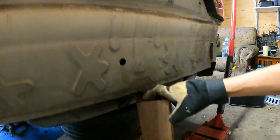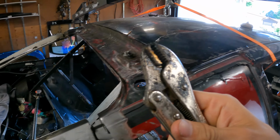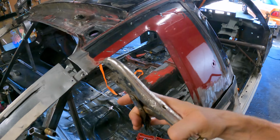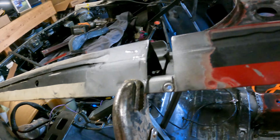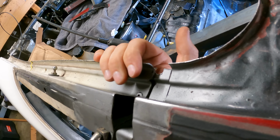So with this C-pillar, it still has some play, but I don't have any of those fancy metal grips that hold everything in place. So we're just gonna work with what we got. And we have vice grips. We're gonna clamp this on here, get a nice little edge to weld on. So I'll just weld it here. Then I'll probably move it over to here so I can get this side squeezed down nicely. And then we'll hit the bottom. The welding is so much fun, I'm not gonna lie. I love it.